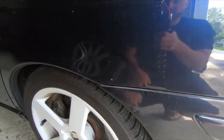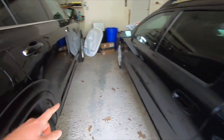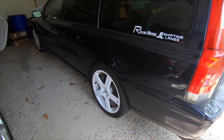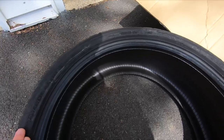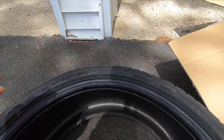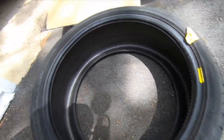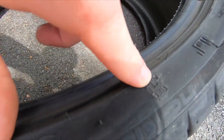This whole car is filthy — I need to really do a detail. I just detailed the XC90 and I'm putting out a video next week on that. It's absolutely insane what we were able to do with Avalon King's Armor Shield 9, but that's coming in another video. I have Nokian Hakkapeliitta R2s on the winter wheels, and these are the Z-Lines by Nokian — 235/35 ZR19, 91Y, extra load rating, which means they are rated for a lot of weight, which is excellent. That's exactly what we want because Volvos are heavy.